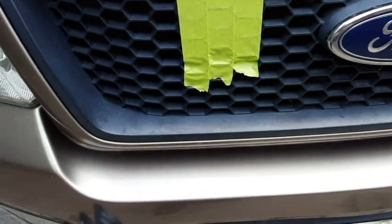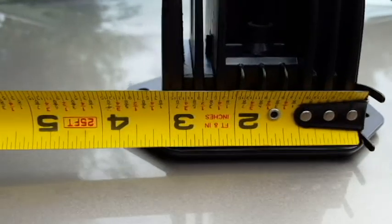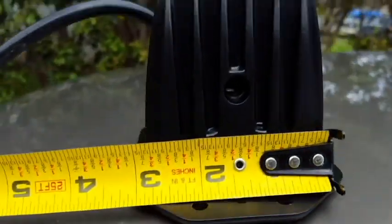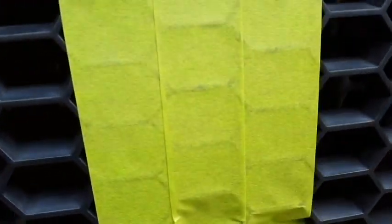Moving on to the grill lights. In the meantime I'm painting — I touched up those brackets with some heavy-duty paint, so those are drying. To mount these lights, first check the clearance. The light measures about three and one-eighth inches, so I'm going to cut at three and a quarter to allow a little adjustment sideways. In the other direction it's exactly two and seven-eighths, so I'll cut right at three inches. That gives us three inches tall and three and a quarter inches wide.